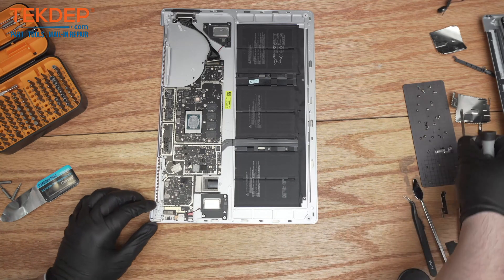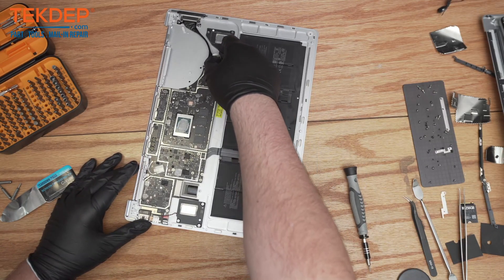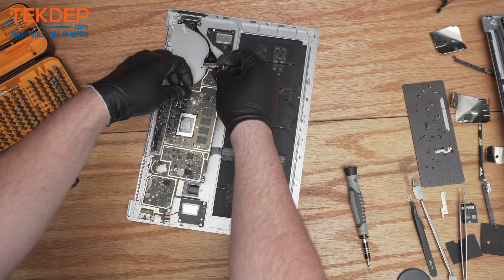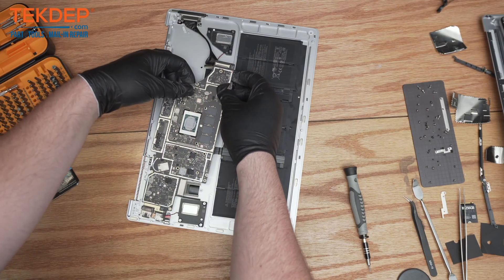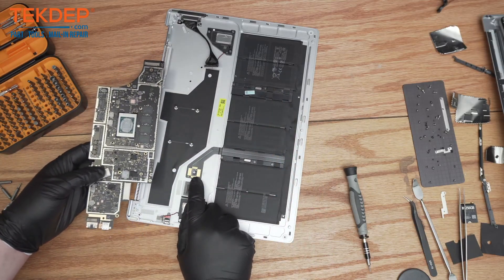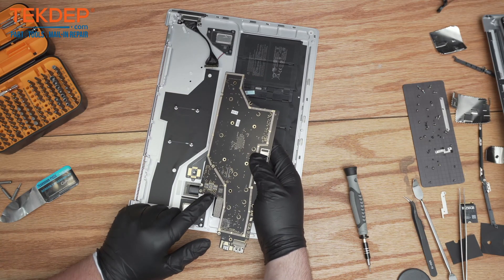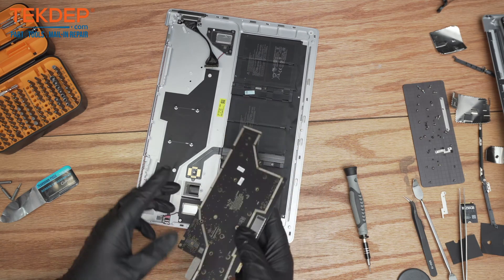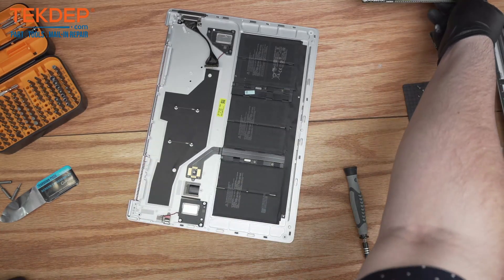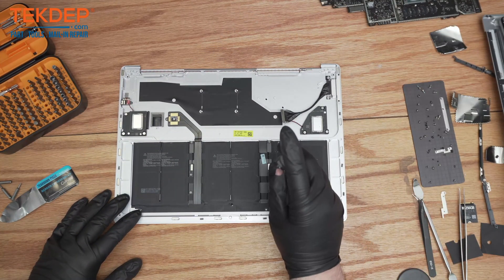All off. Now we can actually lift up the motherboard and get it out of the frame. That's the motherboard disconnected, and that also just disconnected the battery — it is held in place onto the motherboard by these pins here and this pad. Now it's actually disconnected. So if you were trying to replace your battery, now you'd stop and take out the battery, which we're going to do right now.